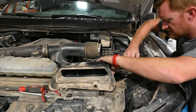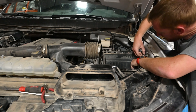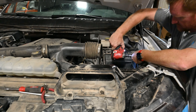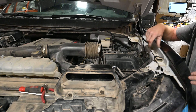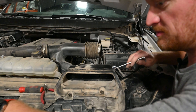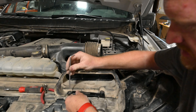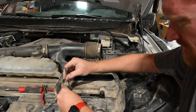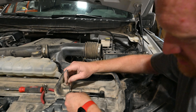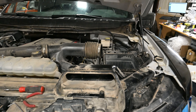Before we drop it down in there, we're going to throw the clip nuts on the frame. You can see where I had them on there when I was testing this — they go right in those two square holes, kind of the upper ones by the suspension. Just go through the holes right there and push them in. The other one is right here, it's kind of more vertical. Now we got both those in there. Just make sure the round hole where the thread is is lined up with the hole, and then we'll drop the compressor down.